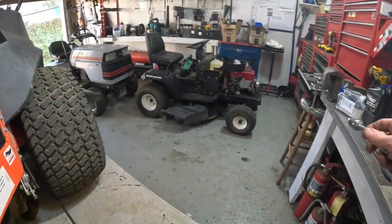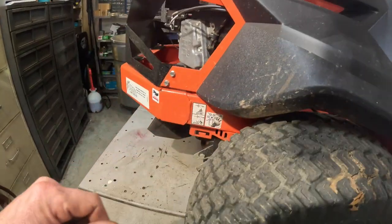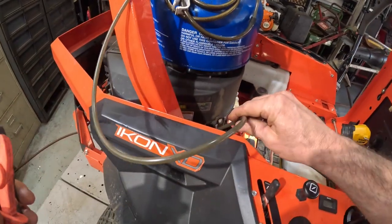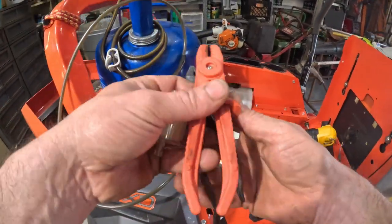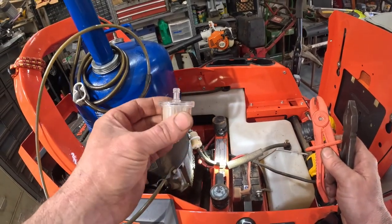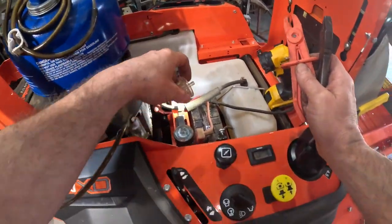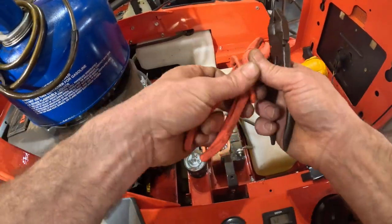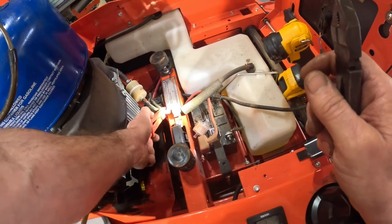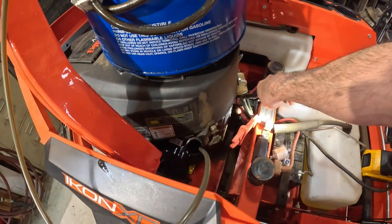Let's check the oil — is it still slurping? It is. While this thing is still sucking the oil, I'm going to swap this fuel filter. This one — I don't know if I like this fuel filter. That's a big automotive style filter there — I like that. This may not be the original. It's a universal style filter part number 490190031. I know fuel is going to come back out of the fuel pump all over the place — I've already got a mess to clean up anyway.